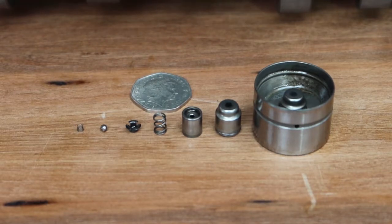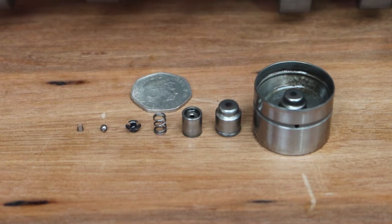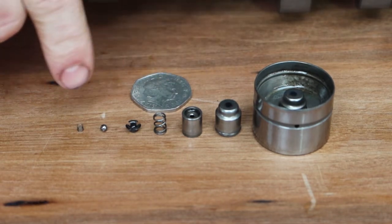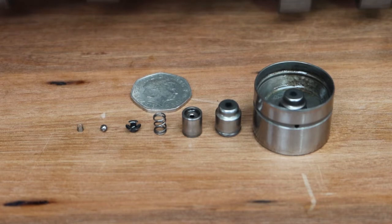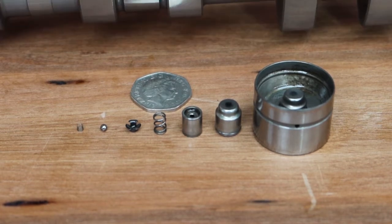This is a hydraulic lifter, and during normal operation it fills with oil which sets the lash. But when rebuilding, we always want to strip it down into its pieces and clean it, as they can get gummed up with oil. Also, especially with a new cam, it can overcompensate leaving the valve open.